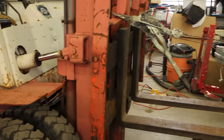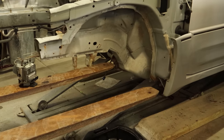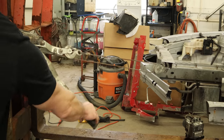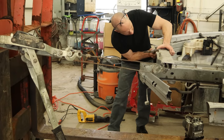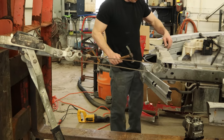So we clamped it up to our mobile frame rack. The fork is just sitting on the mount, the subframe in the back — we can pull against that. Since we're pulling straight back, it shouldn't be a problem until it is. So we'll pull that upper tie bar first — that's pretty easy. Get it back about where it belongs and we'll hammer out the pieces that are attached to it to stress-relieve them and get all the kinks out.